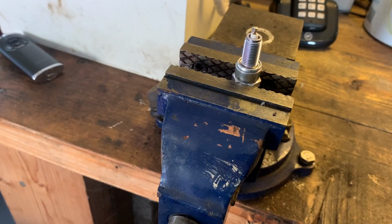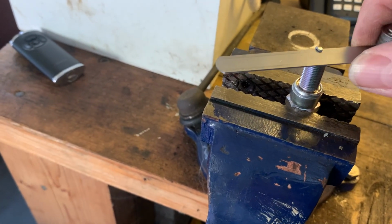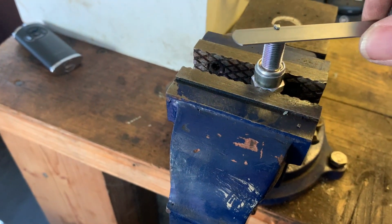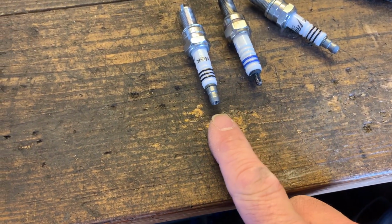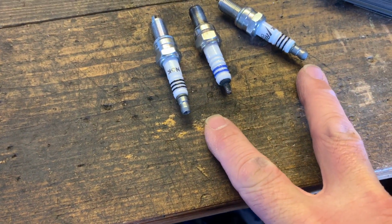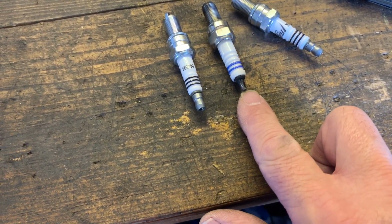The second plug in the vise. Put the feeler gauges in there, give it a, yeah, to be quite honest with you, I'm happy with that. Nice bit of drag on there. Quickly point out, that's a new plug, that's a new plug, and can you see on top there's two pieces that we don't need, so they'll unscrew to leave the plugs looking like that.